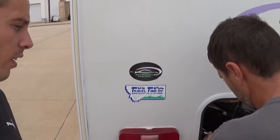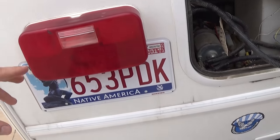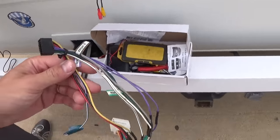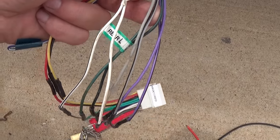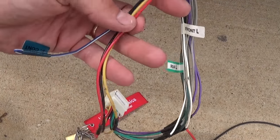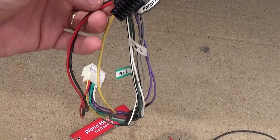Now we're thinking about connecting it to the tail light so when you turn the lights on it activates the transmitter - that way the camera will work all the time so we can see behind us, not just when backing up. We connected it there, hopefully we got it right. This connected piece is for the radio system, the CD unit. I disconnected that so I can work outside instead of in the hot camper. The wires paired by two are for speakers, so we don't need those. The black one is ground, the positive is there, and the yellow one should be the accessory line - that's what we need, along with the black ground for the receiver.